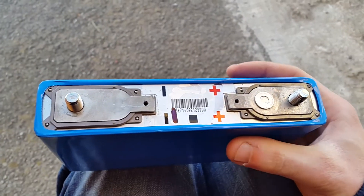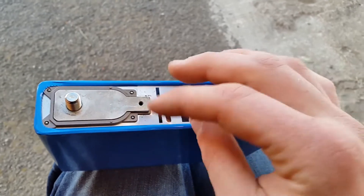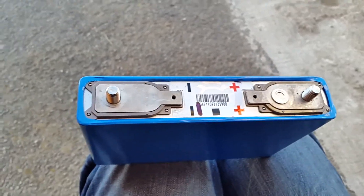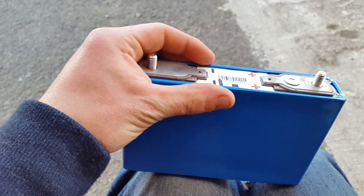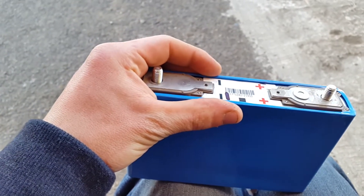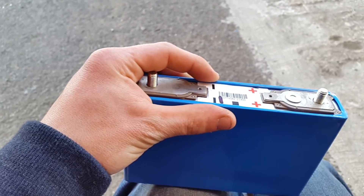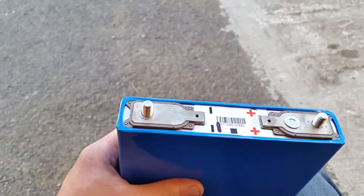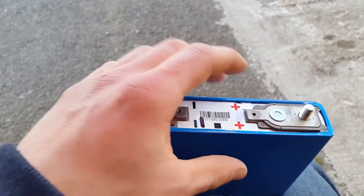The Mitsubishi Outlander has two 60kW motors, so that's about 120kW maximum that the pack had to deliver. I did the calculations and it was about 400 amps being pulled out of this cell — which is a ridiculous amount of power, around 10C I'm sure.